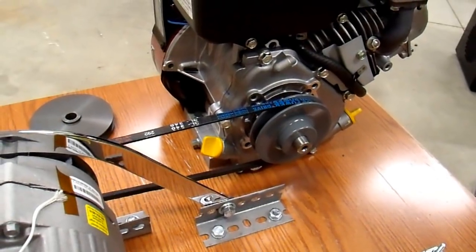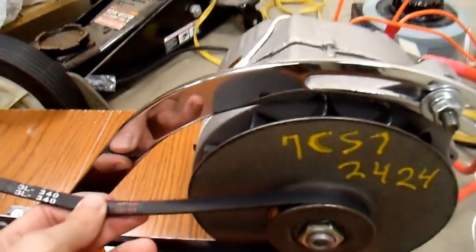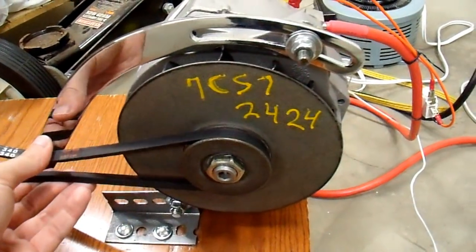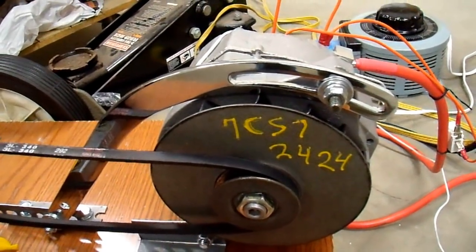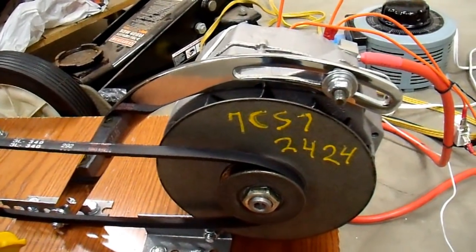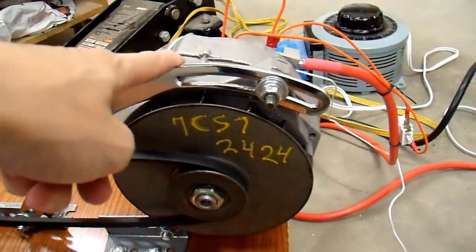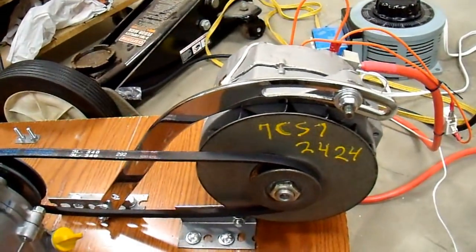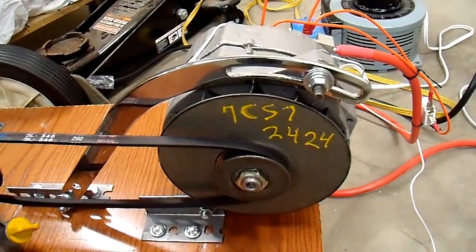So I tried this setup here — I didn't have to buy anything for it, I had all the parts already. I just zipped off the 5-inch pulley, stuck this one on, and replaced the belt with this 3L style belt instead. I also had to change the pivot point so that the belt was the right length. I thought, well, if I spin the alternator faster maybe I'll get more amperage out of it. And indeed, in this configuration with the alternator spinning something like twice as fast as it was before, I now get basically 100 amps out of the alternator. However, because the alternator is spinning this much faster it is also quite a bit less efficient, and my engine over here labors pretty hard. Also I can't adjust the output current by changing engine RPM because it's always spinning fast enough to generate 100 amps.